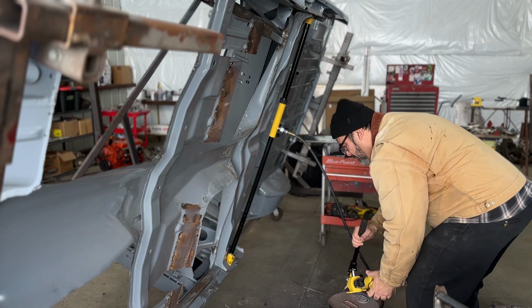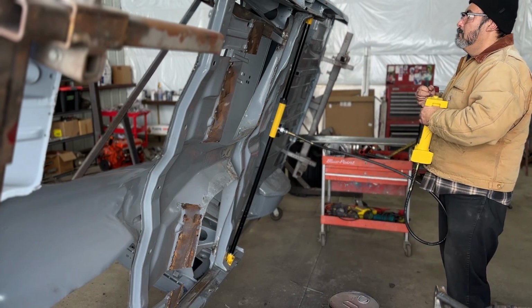it's like, if I would have had to pull on this floor brace to shift it over this way. Luckily, I was able to spread it out and get that one side to go out a little bit with the porta power. Because if I would have had to pull on this side, I would have had to cut off the existing structure for the inner quarter panel, because I had already welded it on, and I would have had to drill through that brand new part that I had already installed on that floor brace, which is the inner rocker, which hooks to it. I would have had to drill 4 big holes, screw a plate onto it with a nut and a bolt in 4 spots with the hook on it, and then pull it with a chain. So it would have been a nightmare.